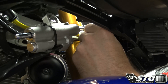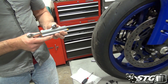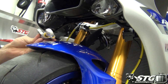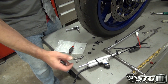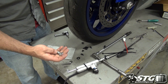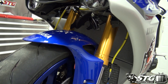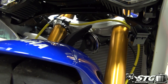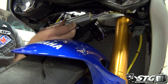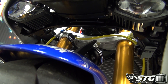Okay, we're ready to install the damper. It's going to mount up like this. It comes with a bolt, a spacer, and two washers. You're going to reuse the stock nut from the heim joint side, and the stock mounting bolt from the center position. They want one washer on each side. This has 18 clicks of adjustment — I backed it off to zero, which is going to allow me to move it around much more easily.